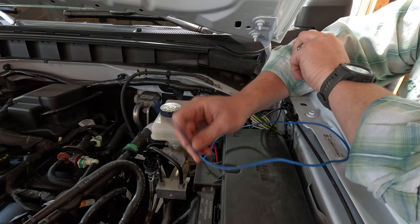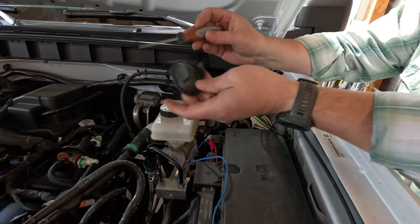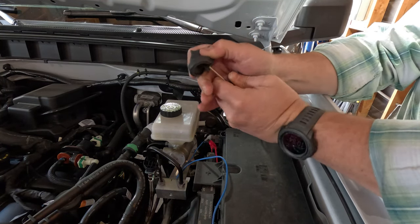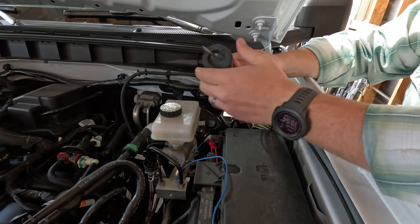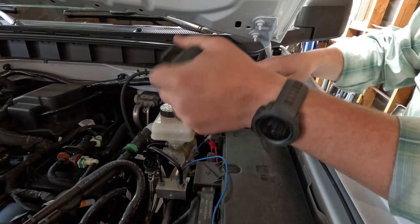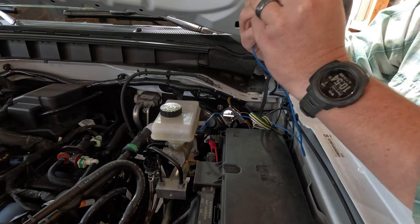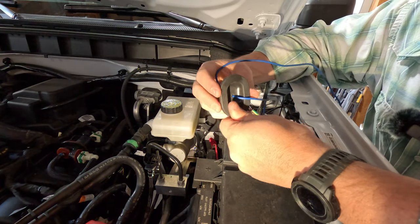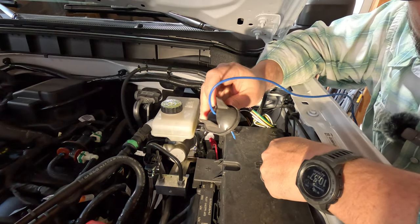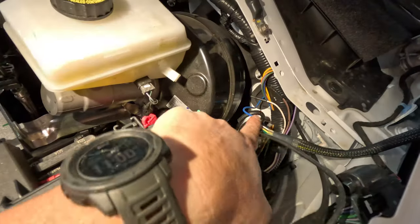So we're just going to come up and pull this guy out so that we can poke a hole through it and run our wire that way. Here's the blue wire I was telling you about that we ran in a previous video — you can check that out below — and here's that grommet. We're just going to stab a hole in here, try to keep it right in the center. And we're not drilling this out — instead we're poking it so that when you put the wire through it's still a nice solid seal. Now I'm going to install the grommet so this will be on the outside and this will now be on the inside. That way I don't have to fight with that wire up underneath the dash. So there it is going through the firewall — we'll just get this up out of the way.